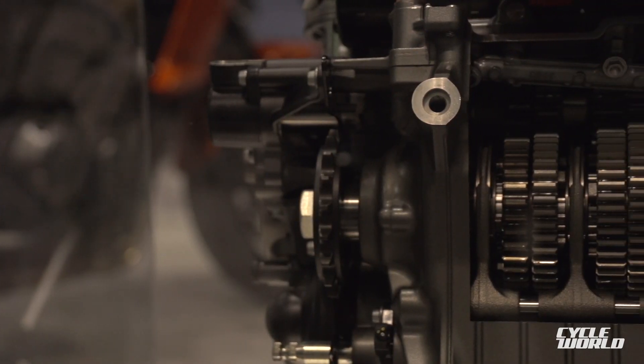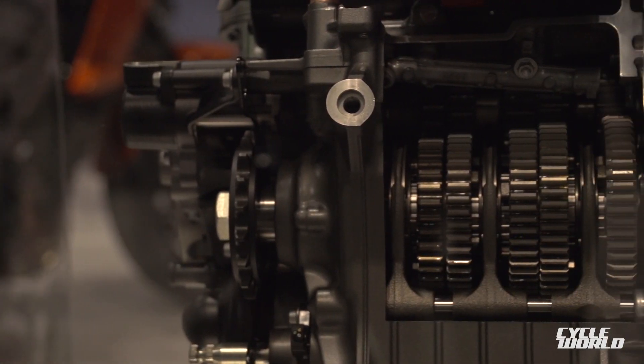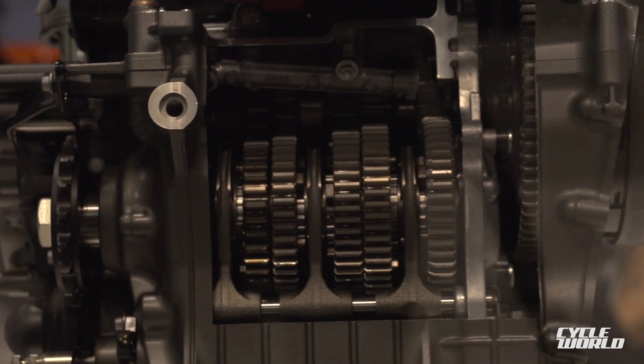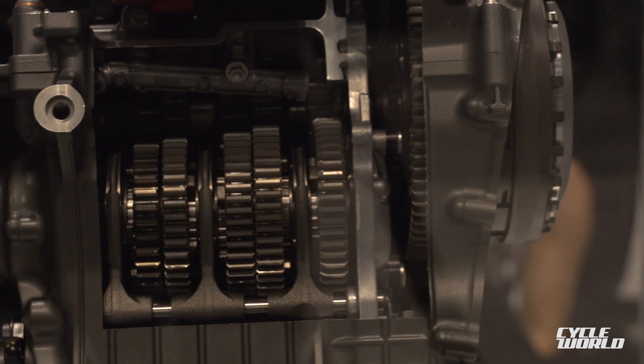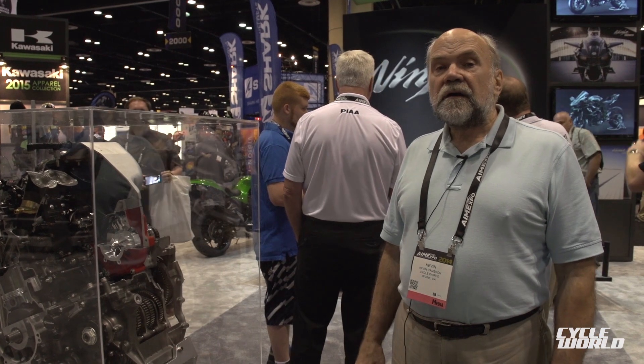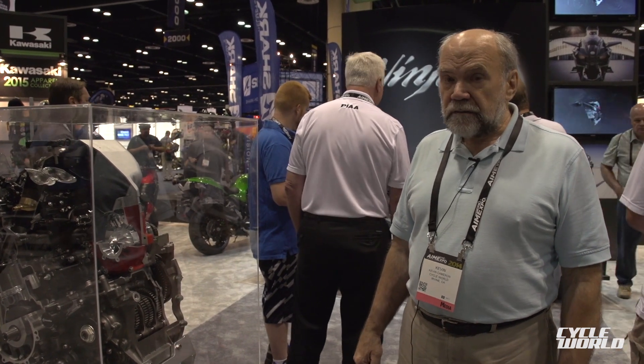This has the advantage that the gears themselves can be quite narrow, because they're always located perfectly with respect to one another since they don't slide laterally at all. Kawasaki tell us that this type of transmission is used in their short-lived MotoGP project engine.